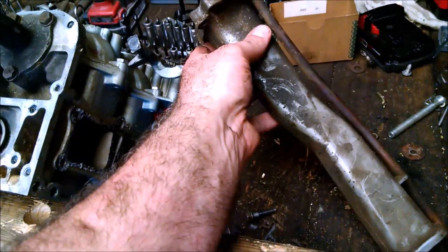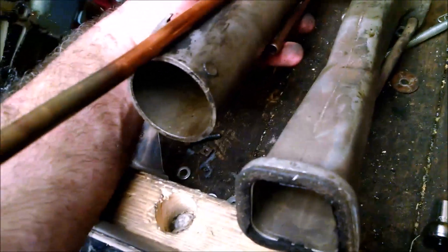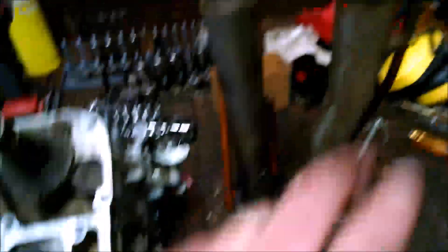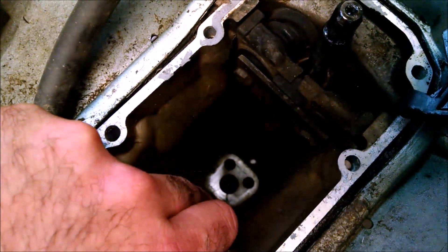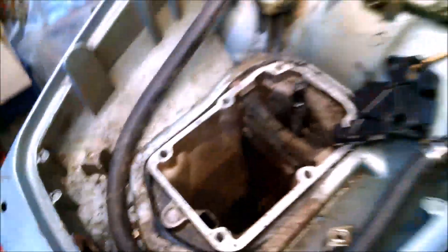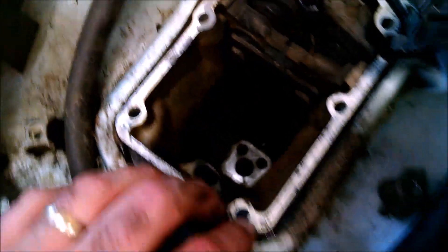Some other ones from other years do have side reliefs, but this one doesn't. Another notable difference is the length of the exhaust — this exhaust here is slightly shorter. The reason for that is the old exhaust seals up perfectly against that surface, whereas the newer exhaust gives it a little bit of a space. I think — though I'm not sure on this part — that's to relieve the differences in back pressure between the two motors. We're trying to go over 15 horsepower with this.